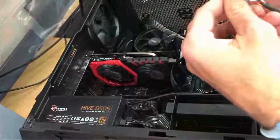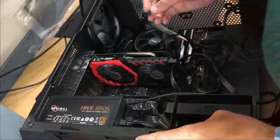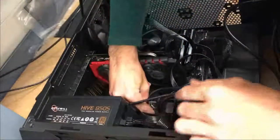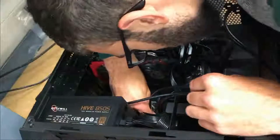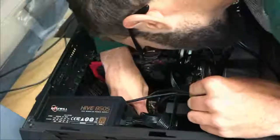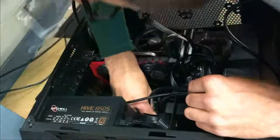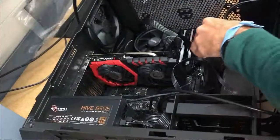Now we're going to install the USB 2.0 instead of the USB 3.0. USB 3.0 is faster, so it has more pins, so it requires that blocky connector. This is USB 2.0. Its speeds are slower, but it's still the same connector type, same physical connector. And we're going to plug this into the appropriate header as well, also named USB.